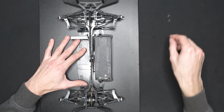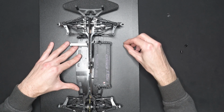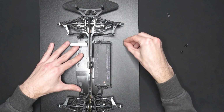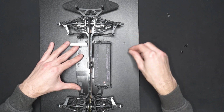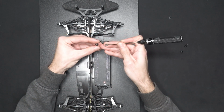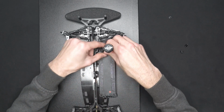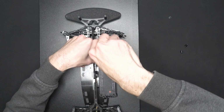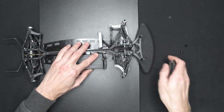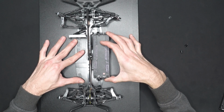And last but not least, we can install these P68 adjusters. So depending on the orientation, you change the fore and aft play of the battery. So you have 4 different orientations for 4 different lengths by 0.25 increments. And I know that in my case, I will use only one in the shortest position. I'm gonna install it at the front. Like so, and now I have the perfect amount of play in my battery.